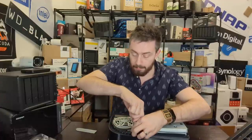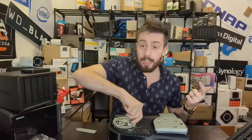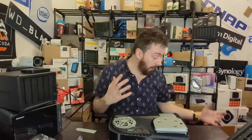Today we're primarily looking at the ambient temperature of the PlayStation system during gameplay — we'll play Far Cry 6 and Demon's Souls, and also do heavy read and write activity. The key question is also: what temperature will this SSD encounter? If the negative pressure cooling system is being undermined by these vents, you have to anticipate that the SSD may get hotter as well.